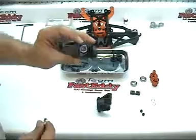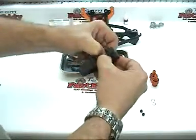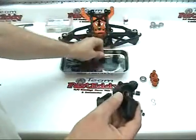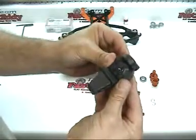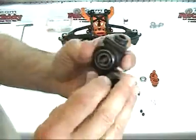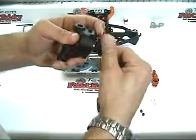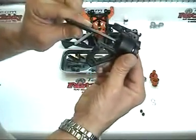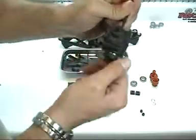So what we're going to do is use the bearing press tool. We're going to leave that one in there, take the second one and drop it in the back side — it's not wanting to seat all the way in. We grab our bearing press and go from the back side with the part that has the screw through it, and it seats down into the bearing just like so. Then we take the wing portion that has the nut in it and screw that on from the front. Just screw it in — hold the back with your wrench and gently screw — and it's going to seat the bearings in just like so.